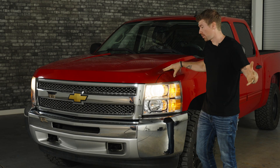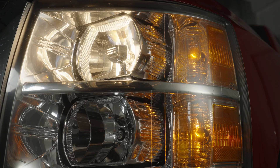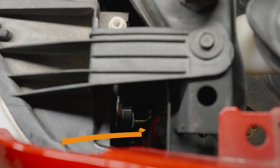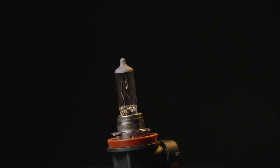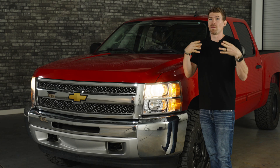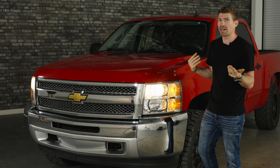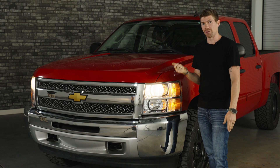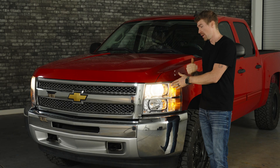13 years ago when I upgraded my own bulbs from Headlight Revolution, I had a looming problem and that was fitment. Very few bulbs would actually fit inside of here because there's a metal brace on the back side that won't allow you to get a bulb in. You need an H11 bulb, but some of those H11 bulbs for your low beam are very big — the base is super large. Not anymore with the GTR Lighting Ultra 3 bulb. It actually fits. You can cram your hand in there; it's a lot easier than others, and you don't have to pull the whole grille and remove the headlight to get it to fit. That is a plus.